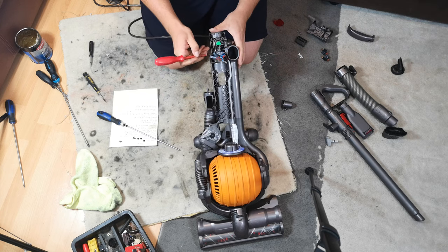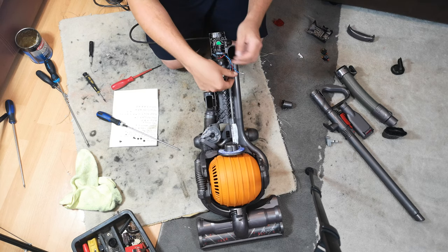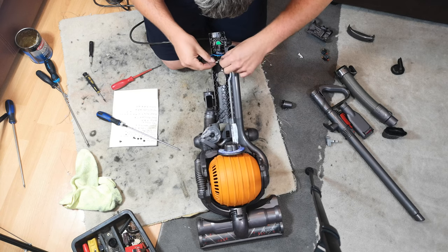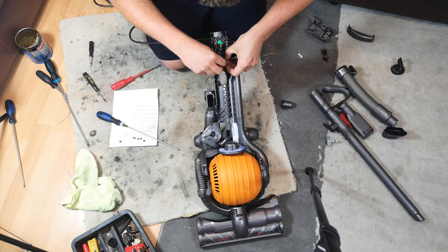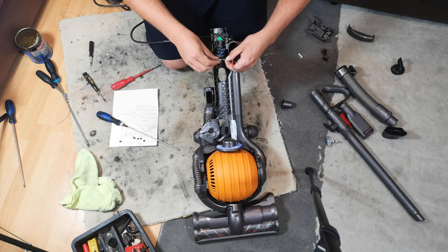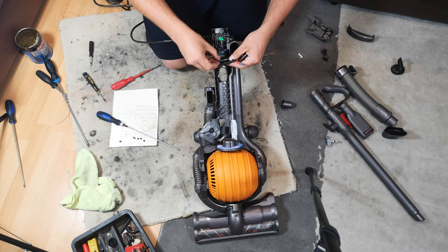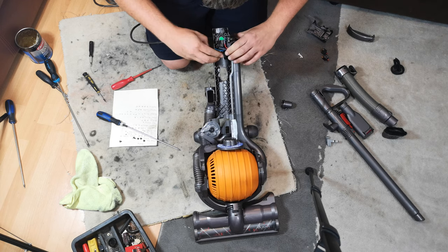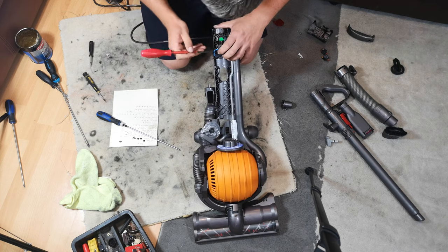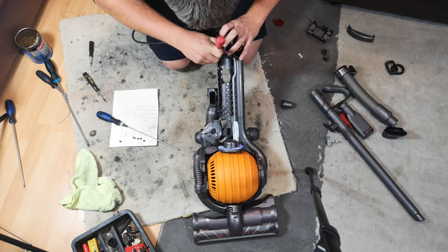So we put the mains cable in, feed the bulk of it around where it needs to go. So I'll unpick some of these wires, because we need to plug the neutral together, because the neutral isn't switched. There we go. And then pop that into a little house, clip it together, and then it snaps back into there, and all the wiring sort of pushes itself around the place a bit, out of the way.